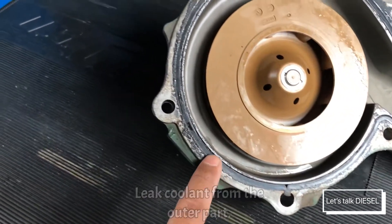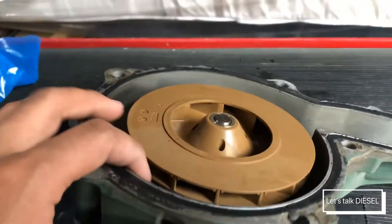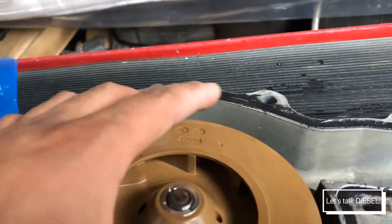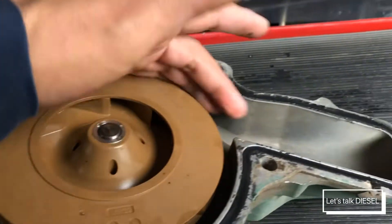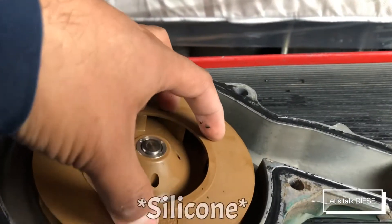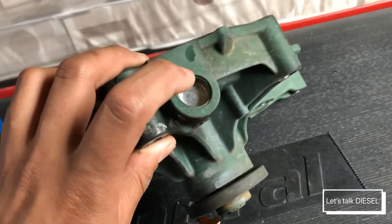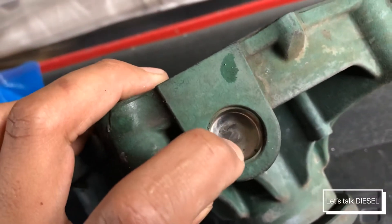I never see that plastic propeller get loose and start leaking coolant, and it never breaks. Checking the gaskets that go around — Volvo water pumps don't come with the gasket, so you have to install the gasket yourself. I suggest when you do that, use a little silicone — not too much, just to hold the gasket in place. I have seen other techs not put any silicone on it and then it starts leaking coolant again after just a couple thousand miles.